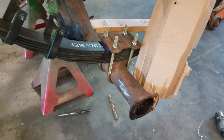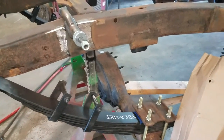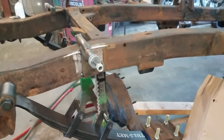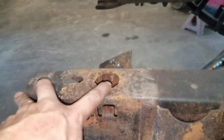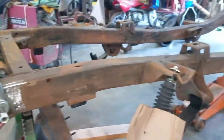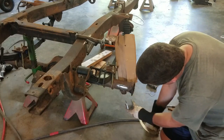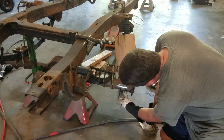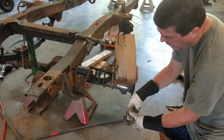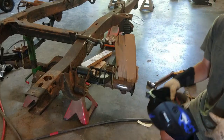Once it's all cleaned up I'll finish welding it out. I'll get it tacked in place, check the fit, then transfer to the other side. We also have two body mounts to fix, and then I believe we'll wrap up most of the frame fabrication. My two marks show where this bracket goes — the bottom corner butts up against the original bracket, and this piece is radiused where it welds to the housing. I'll tack it in place and we'll see how it looks with the shock on it.